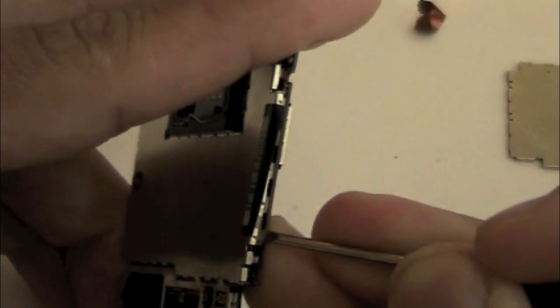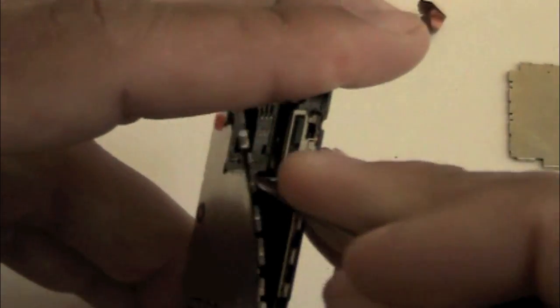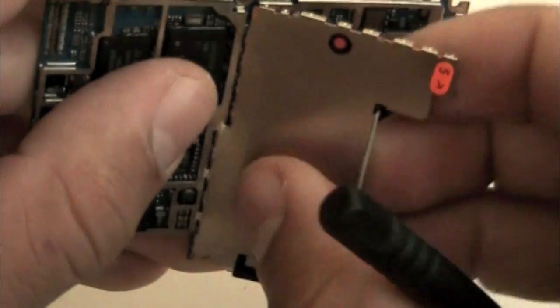Also, whenever you're underneath the plate, make sure you're not digging down to damage any of the chips. Once you get the bottom plate off, move to the top plate following the same process, working all the way around unclipping the clips. Note that on the 3G phones they are soldered on the bottom just a little bit, so once you get the top section of the plate off, the bottom will still be attached — you'll have to bend it back and forth and that solder joint will just break. Bend it back and forth a couple of times and it comes right off.